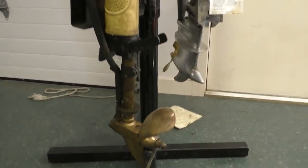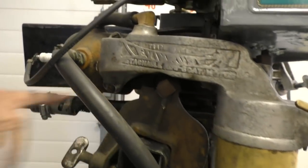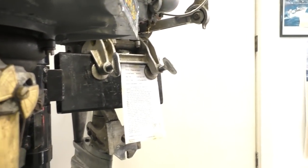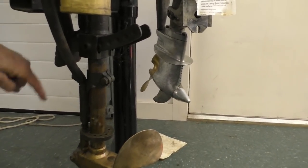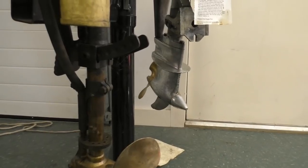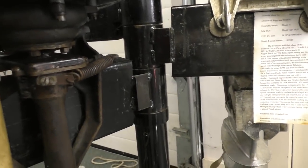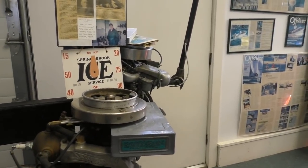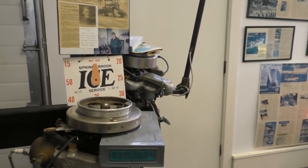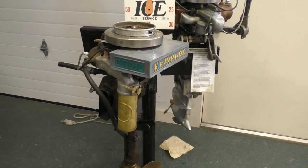This is not a lifting of the handle but a rotating of the handle, which unlocks a mechanism up under the power head and allows the lower unit to rotate freely. The lower unit would rotate around and lock in the reverse position — so now as an operator of the boat you are moving in reverse. This mechanism is up in this box right up here. Then another twist of the handle in the other direction and the lower unit would unlock and relock in the forward position.